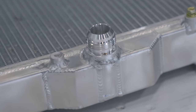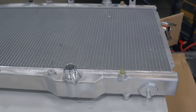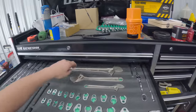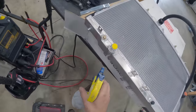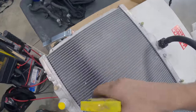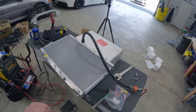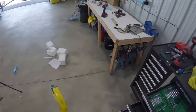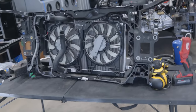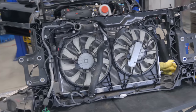It's not the most beautiful welding in the world, but it's definitely my best aluminum welding — very pleased with it. Before I call this a wrap, I'm going to go ahead and pressure test it. We got seven PSI in there. That one's good — look at that, no leaks! First successful weld job we don't have to patch with our TIG. Great success. Let's get this radiator onto the core support, get the fans on, and then start building the dash-16 radiator hoses.